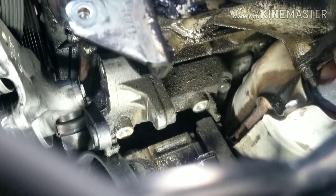That shock on the tensioner sometimes wears out and puts too much or not enough pressure on the belt. Sometimes the pulleys themselves wear out — look at how that's just shaking right there, that's worn out, and that one's worn out too. The whole assembly is worn out, which is apparently why Honda redesigned the piece. Some people will try to replace just one component, but it's all made as one particular piece, so just go ahead and get a new one. It is an expensive part, but it's cheaper than the whole car — without it you can't drive.